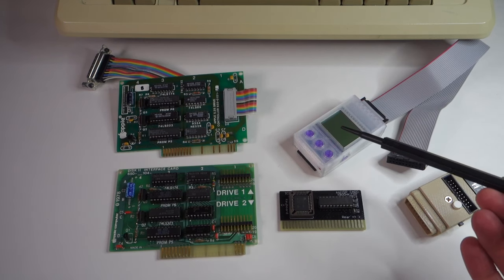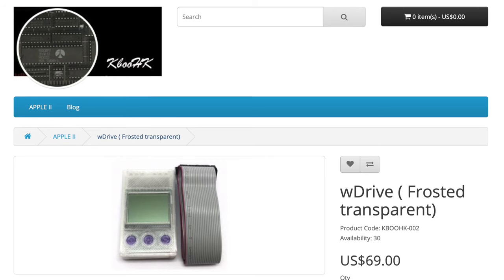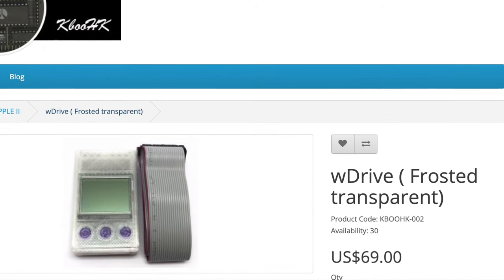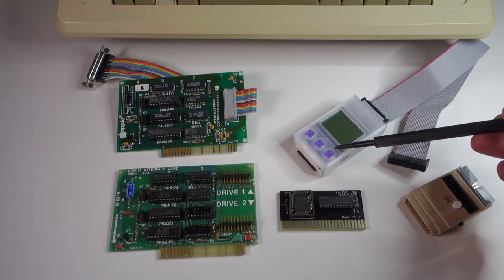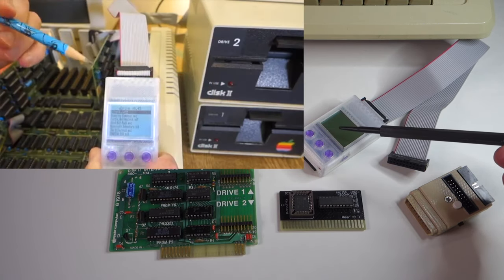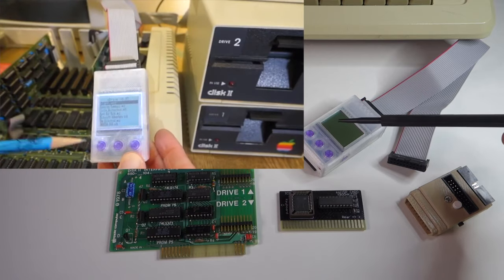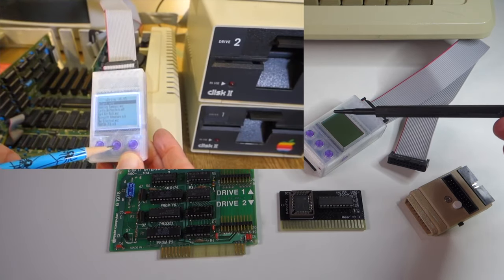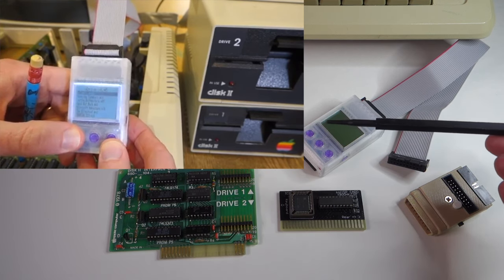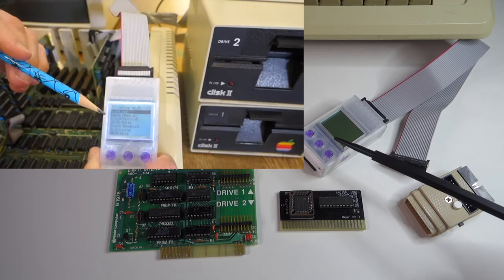Back in episode 85, I did a video review of the W-Drive from Kaboo HK. The W-Drive is an SD card solution for the Apple II line of computers, which lets you emulate a floppy drive using an SD card. It can handle all sorts of disk images, including DSK, DO, PO, as well as WOZ images, and it was also able to handle 32 megabyte 2MG files. But the problem is that on a 2 or 2 Plus or 2E, they don't have support for SmartPort like a 2C or a 2GS.